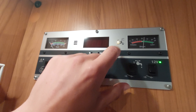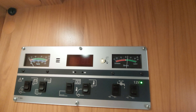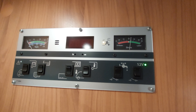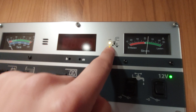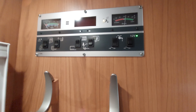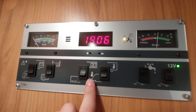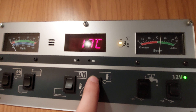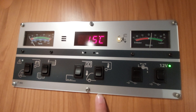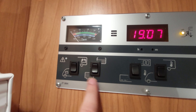Coming back up to your control panel, you'll notice some gauges. As indicated by the light, we are plugged in and receiving 230 volt power — this is a great indicator if you have a fault and can't get 230 volt to the vehicle; just ensure this light is on, as that indicates a fault with the van rather than the site. Clicking the next button will indicate the time, and the button next to that shows you the inside temperature as well as the external temperature.